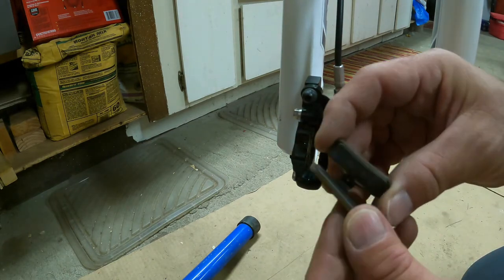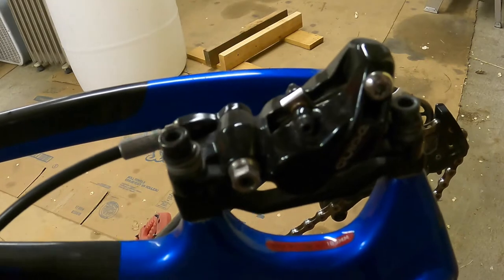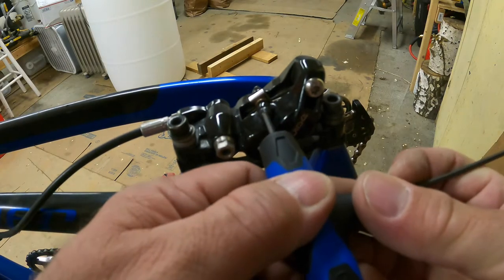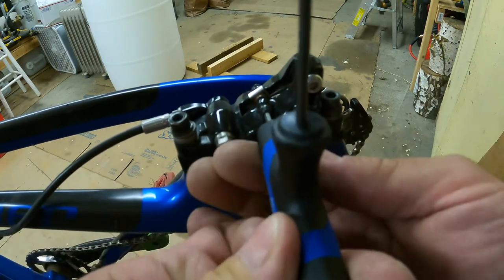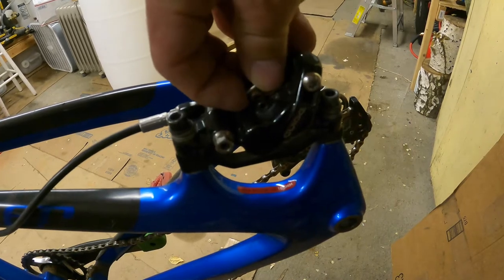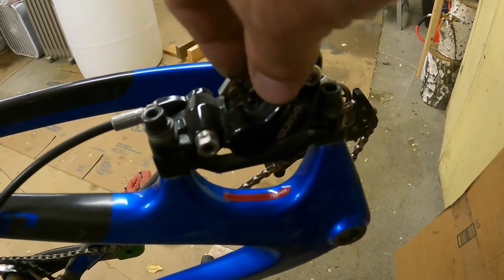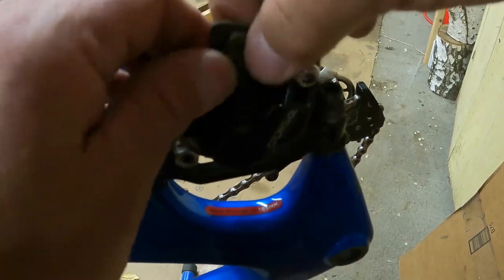I've got my pads — while I'm here I'll go ahead and inspect my pads. Now we're on the rear brake calipers. I'm going to use the needle nose pliers to remove that locking ring, put it in the magnetic parts bin, and then grab our Allen key and just spin it on out. Then we're going to come in here and grab these brake pads and just pull them straight out.